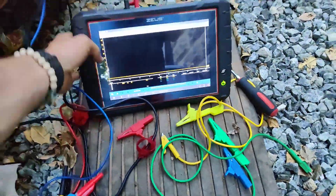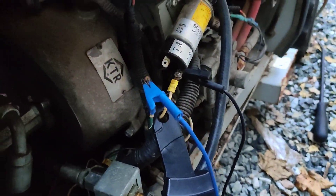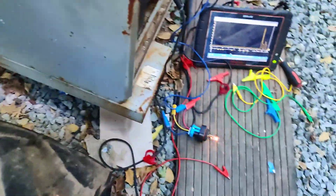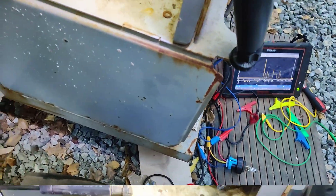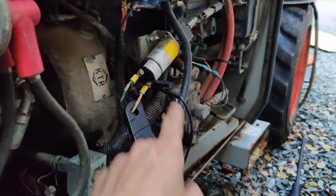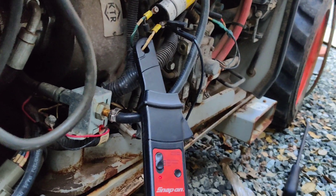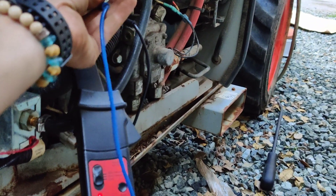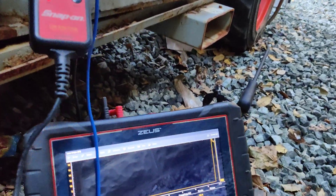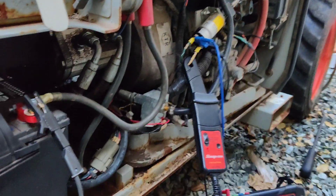My testing was wrong — well, I was right but kind of wrong. I put my headlight bulb on here where the solenoid is supposed to be, because this is power on demand. When I actuate one of the rams, the headlight bulb comes on — that confirms the circuit works. When I connect the solenoid back up and try to actuate it, watch our current — 18 amps. So this solenoid right here is shorted. When I hook my light back up instead, the light comes back on. Shorted solenoid — confirmed.